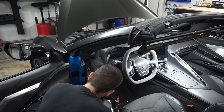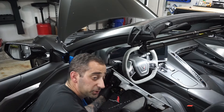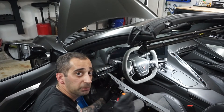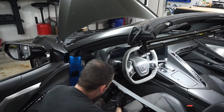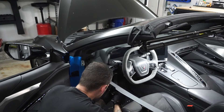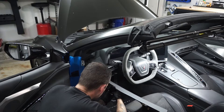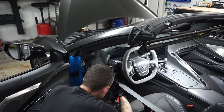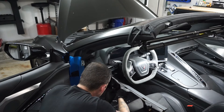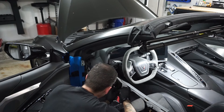There's this one, and then finally this last one is a little bit of a pain because it's upside down. Save this one for last because you can twist the panel around. There's a little gray tab — take a right-angle hook, go in there, grab the gray tab, and pull it back toward you. That will unlock it. Once unlocked, it's a little tricky to get to.